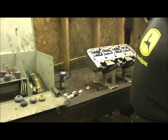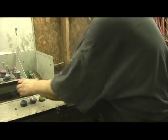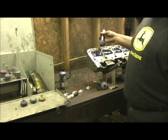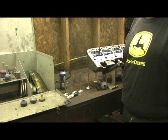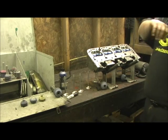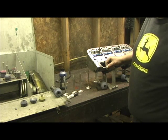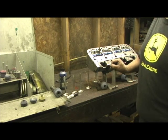When you get them where they're supposed to be, you come in with the 45 with a spring — boom — you touch it and it pulls it in. Now let me show you what most shops do. This is a 45 stone. When you go in and want a valve job, I'd say at least 80 percent — all they do is put a 45 on there, boom, there's your valve job. They charge $150 and it takes them 10 minutes maybe to do it. That is not a valve job. Remember, any time you put guides in you have to do a three-angle cut. I'm going to show you on one of them how I do it.